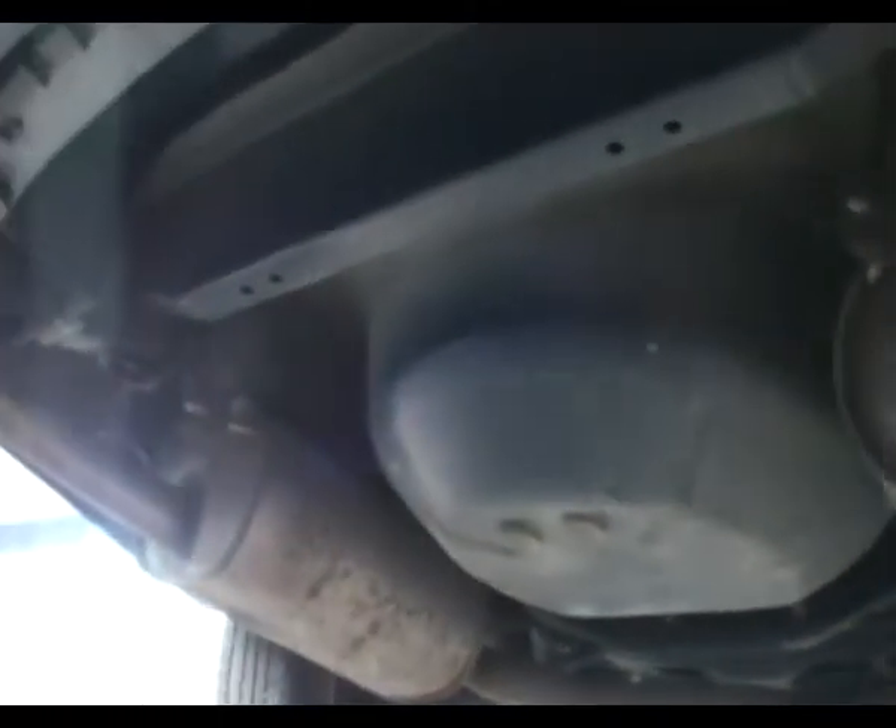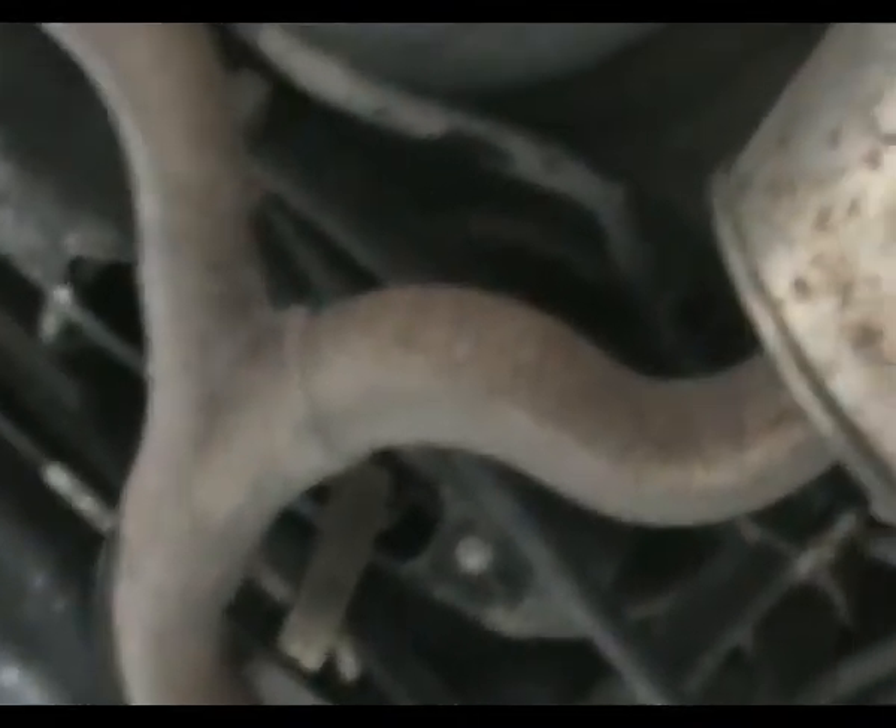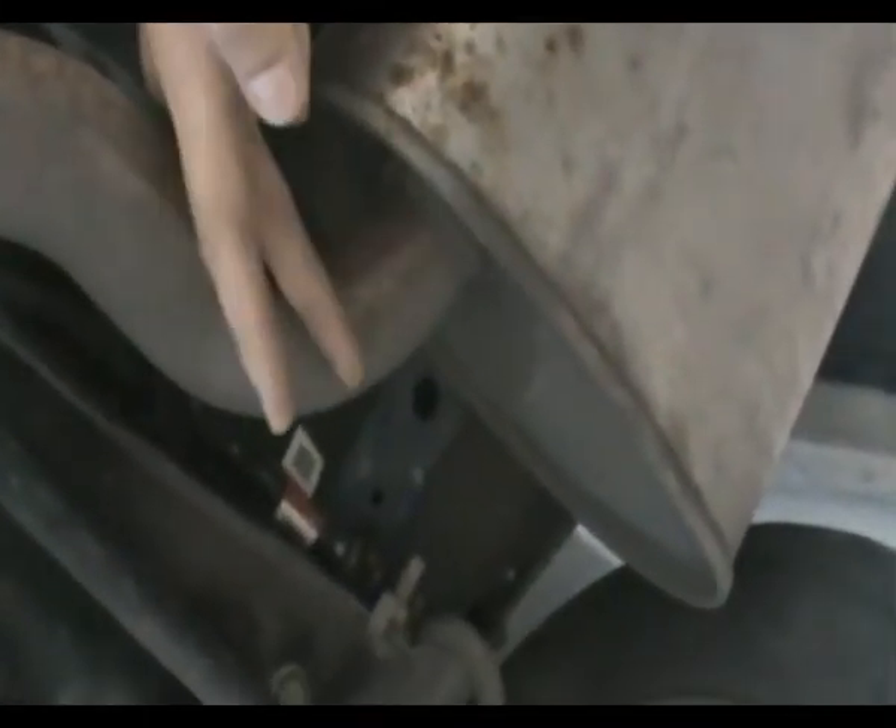We're going to change both of them. The way to do it is you've got to get under your car and see if it's clamped or welded — that's very important to know. In our case it's welded, there's no clamps. If there's clamps, you'll see the pipe that comes from the muffler joint with the pipe from the engine, clamped together. In our case it's welded; you can see the weld at the corner. So to remove this, we have to cut it as close to the muffler as possible, bring the new one, put it in, and weld it.